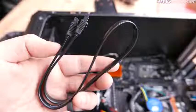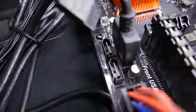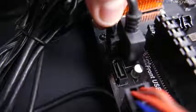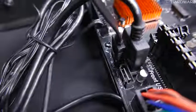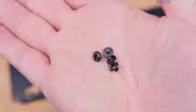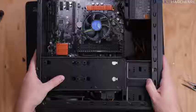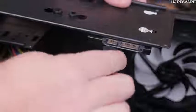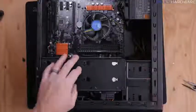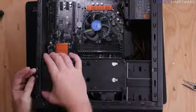For storage, grab the SATA data cable and plug one end into a SATA port on the motherboard — they're L-shaped and only go in one way. I used SATA port 1, though any of ports 1 through 6 can be used. Mount the SSD to the inside of the vertical drive mount with four small screws, pointing the drive's plugs toward the front of the case to hide the cables. The short plug gets the SATA data cable from the motherboard; the long plug gets the SATA power cable from the power supply. Then reinstall the drive mount panel with three screws.